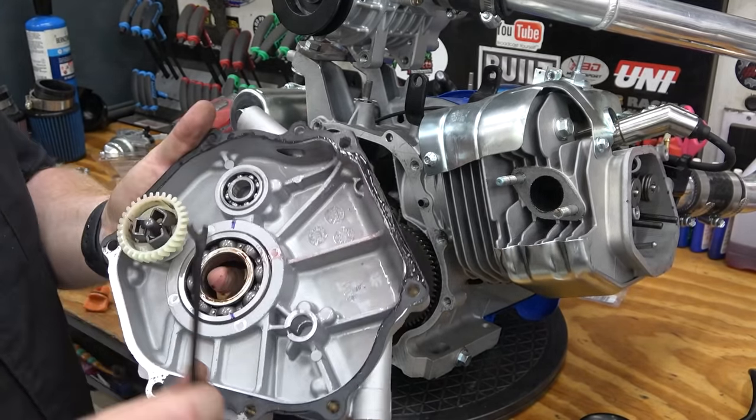We'll jet it out in the next video. We'll start playing with these pulleys. We'll get it right. Then we're going to find something to install it on to see the power. Also, next episode, we're going to be installing a billet flywheel from Go Power Sports because this is getting dangerous with the power levels. So I'm pretty excited, though. I do think it's going to have a sluggish throttle reaction. Let us know of a carb you think will work well that's a butterfly-style carb around 34 millimeters. That's the size I want to try to keep it around.